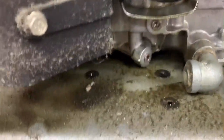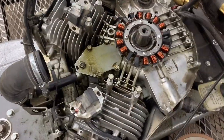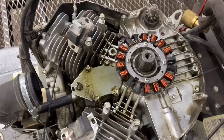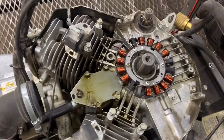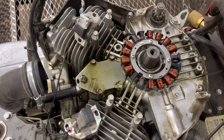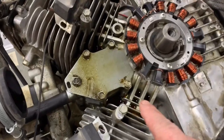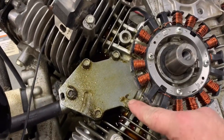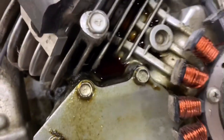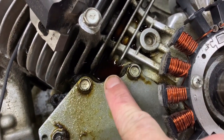So we're going to dig a little deeper. I've already taken the liberty of removing the blower shroud and the flywheel just to save time — I've got videos on how to remove flywheels, you can go check those out. But the main issue is the breather cover gasket; it fails on these constantly. Look at the oil puddle there — the oil just weeps out of the gasket.